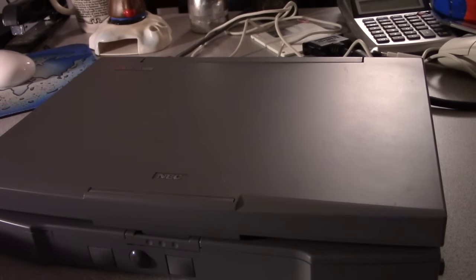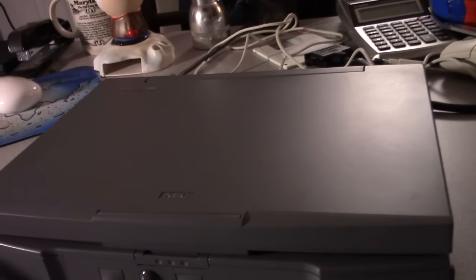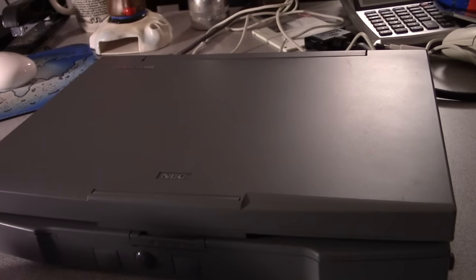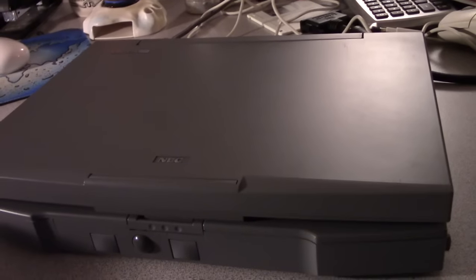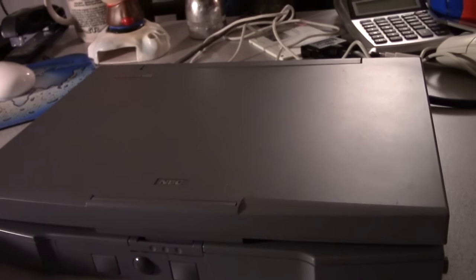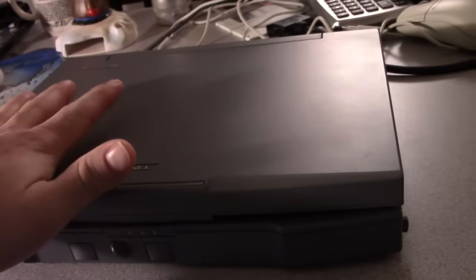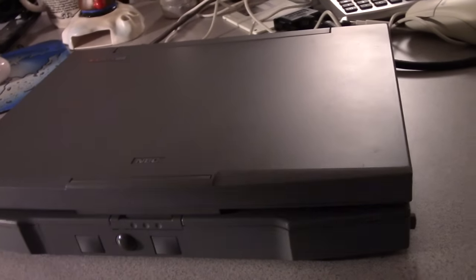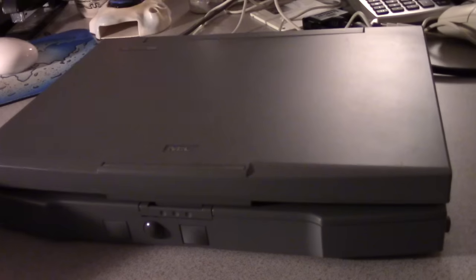It works like the batteries inside a RAID cabinet, where if it's writing data to the drives and there's a momentary power loss, it'll keep the data in suspense until power is restored and the drives spin back up again. The bridge battery is designed to retain contents in memory for about 5 minutes while the battery is swapped or power is applied. But because that battery was now a leak hazard, I had to remove it.